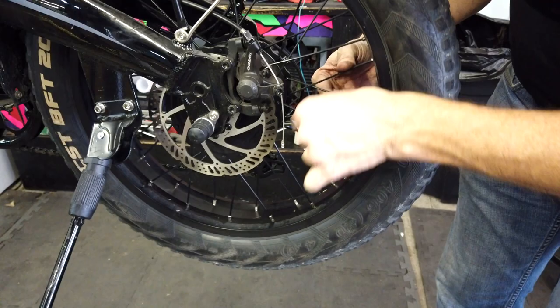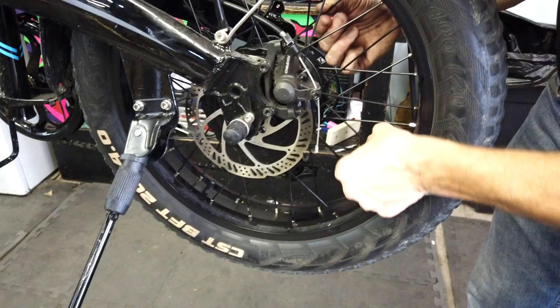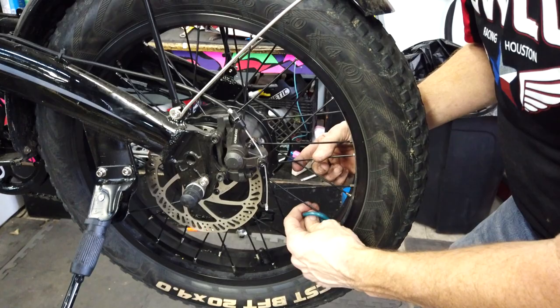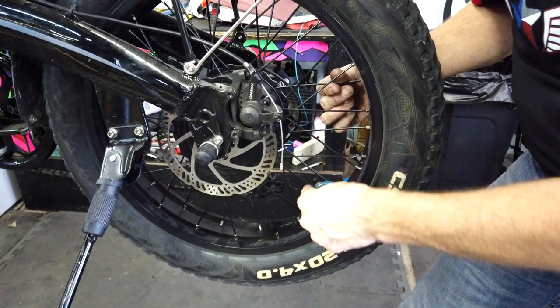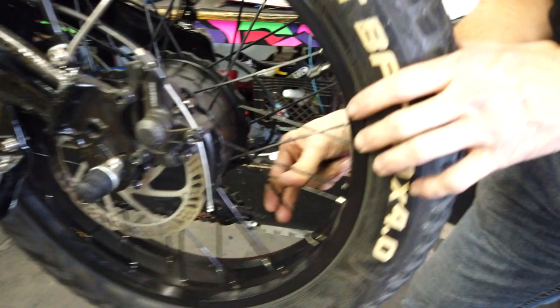They were all kind of loose. And that's the reason why the wheel's still straight — if they weren't all loose, then the wheel would be going all over the place. I first heard the noise maybe a couple of weeks ago, but it seemed like it worked itself out. Then I heard it again like two days ago when I was riding. I stopped, got off, and looked at the bike and was like, what the hell is it coming from? I couldn't localize it. I thought something was hitting the tire, but then I figured out it was all the spokes creaking and popping.